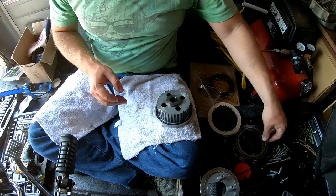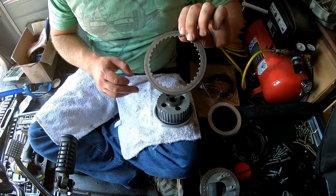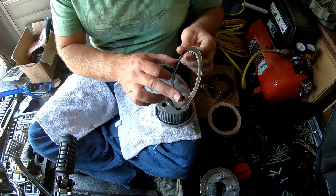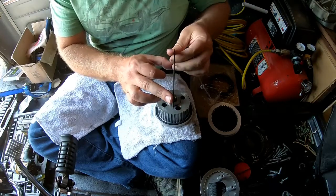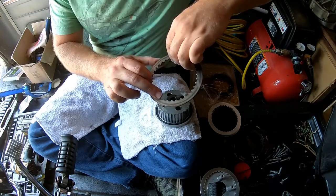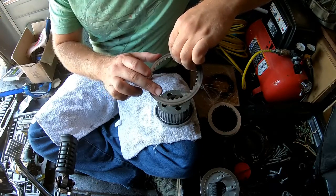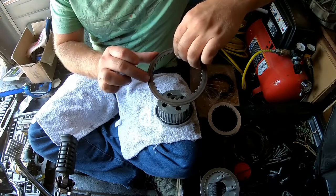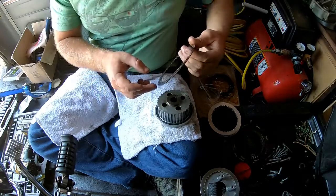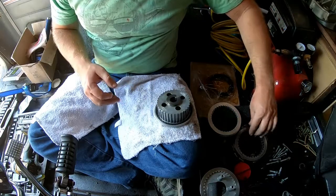Okay? And look, you can always use your old steel disc right here just to look at the wear. So if you're looking here on this disc, you'll notice that on the steel plates there's a machine side that has some abrupt ends, and then you've got the other side which is like more of a casted curved end. Now as you can see, the side that's running my wear pattern for this judder spring is having the machined side facing the motor. Okay, now this is true on everything.